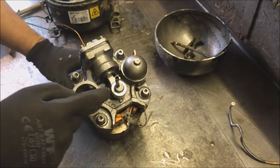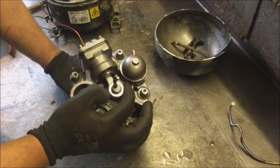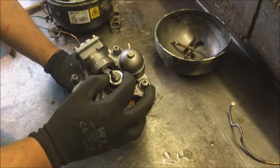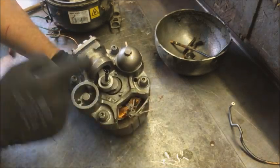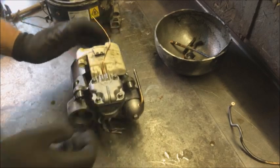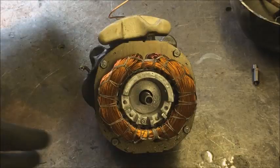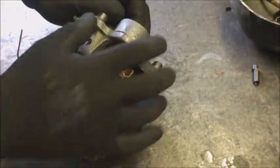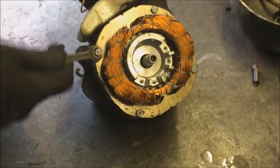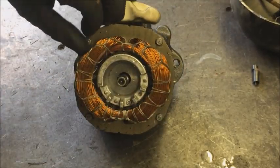How does it work? That piston is on an eccentric cam, so the motor rotates and shoves it up and down, and inside there'll be little reed valves. I don't know how much copper we're going to get out. The pump assembly is attached to the motor with four 8mm bolts, so I'll just quickly whip those off.